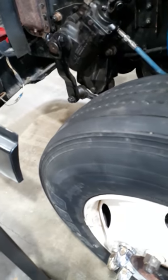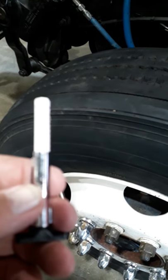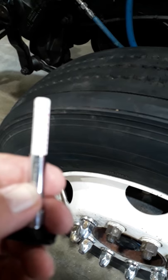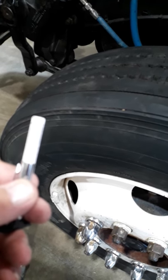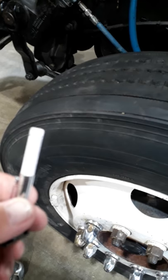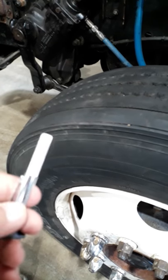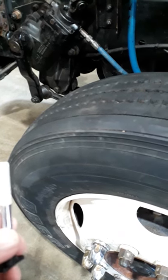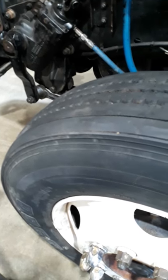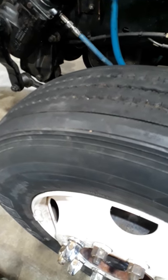As far as some of the tools, we have a tread depth gauge that measures the depth of the tread. It has a 32nds of an inch side and a millimeter side, so we use the 32nds of an inch because that's our specification. On any commercial vehicle other than transportation like a bus, the steer tires — front tires — have to have four 32nds minimum tread, and the rear, drive, or trailer tires have to have two 32nds. That changes if it's a transportation vehicle like a city bus or school bus to four 32nds all the way around, but if it's not transporting passengers, that's our specification.